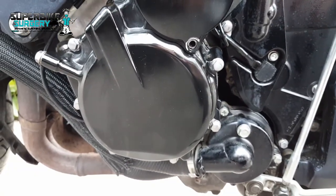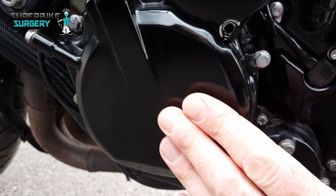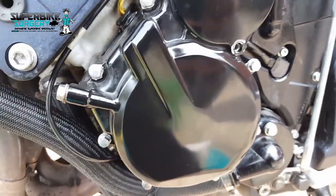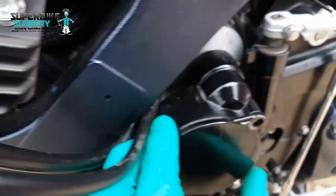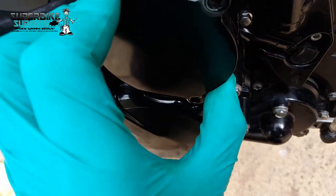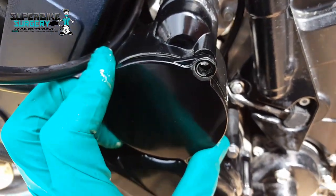So I jump started it - it's still making that noise, but it's not quite as constant. It literally feels like it's the other side of this aluminium - the vibration is... you know, I'd say there was something rubbing on this cover. I'll take this off as it's running and see if it'll spray oil all over me. This could end badly, couldn't it? That misfire's bothering me too - you can hear it coming on and off, there's a cylinder dropping in and out.